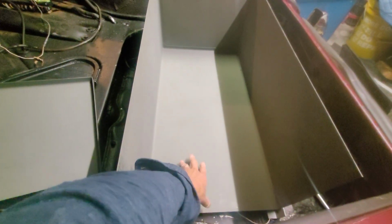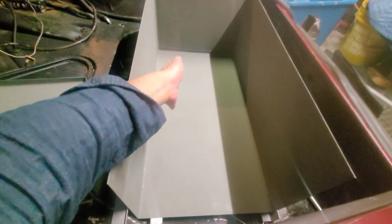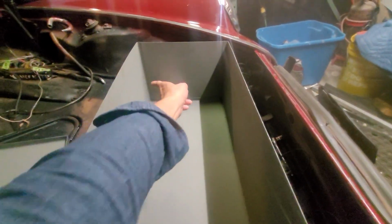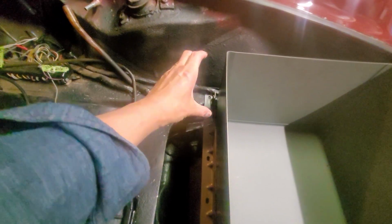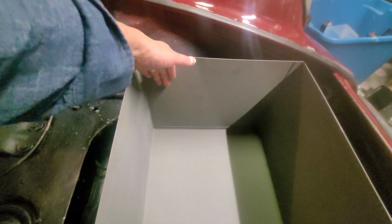I'm going to have a plastic tray that's going to sit on the bottom with slits on it, and each of the Tesla Model S battery modules have a little slit. So that slit's going to go into the little slits in the plastic tray on the bottom and stand up vertically, and then I'm going to have another mirrored plastic tray on the top of the slits to kind of hold that thing in place. Now on the far right, that's gonna be where the electrical is, positive, negative. I'll cut a hole, make a little junction box on the outside. I can have the kill switch on the outside, and all the other contactor switches and electrical components running off of that side. That's gonna be shoved all the way to the end.